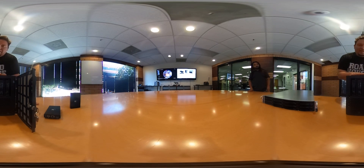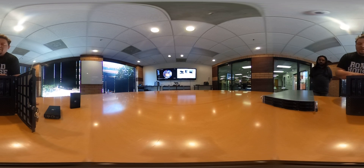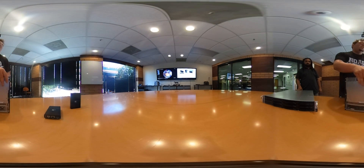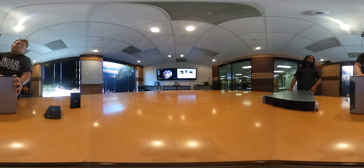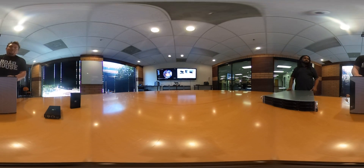It has a dedicated SSD operating system drive. It comes with Ubuntu Linux 14.04 LTS standard, so it's free. You can also upgrade to Windows 10 Enterprise as an option. With four 3.5 inch drives, you've got up to 32 terabytes of storage currently with 8TB drives. It has an Intel Core i5, two HDMIs and one DVI output — meaning you can connect up to three monitors. We sell the NX2 standalone without software, and it comes with tools like TeamViewer for remote support. It's also sold in bundled configurations including a starter pack or a Pro bundle with eight Pro licenses and the VideoWall license, so you can just plug it in and have everything you need.